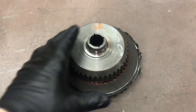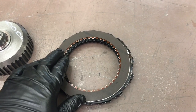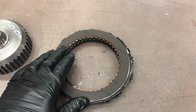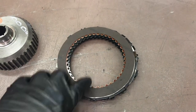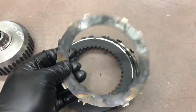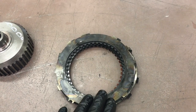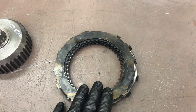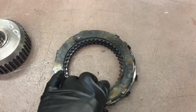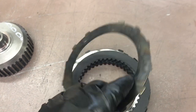The clutch is in the forward drum. When you put it in any forward gear, they just come on. They don't have to come off and on — it's not a shifting clutch, it's just on to drive the rest of the transmission. It leads a relatively easy life. This clutch pack typically starts with a wave plate against the piston to allow some cushion when you put it in gear so it doesn't bang right in. That's the same reason they separate the halves of the piston that apply this set of clutches in the forward drum. I typically leave the inner seal off so I get the full piston at apply time, and I also seldom, if ever, use a wave plate, because with a loose torque converter it won't really bang in gear.